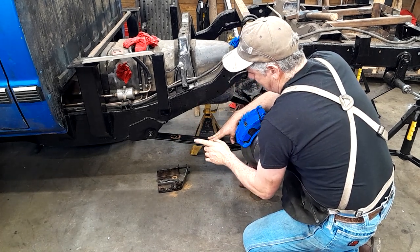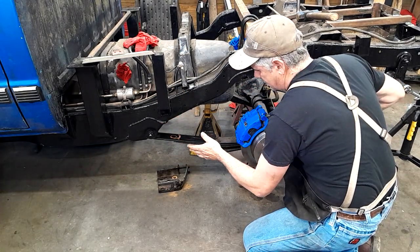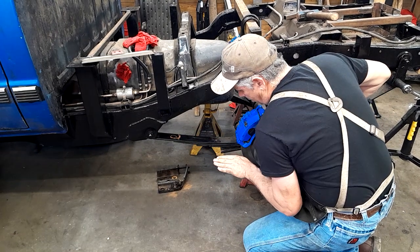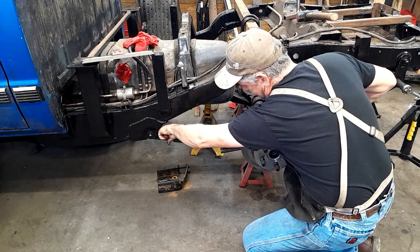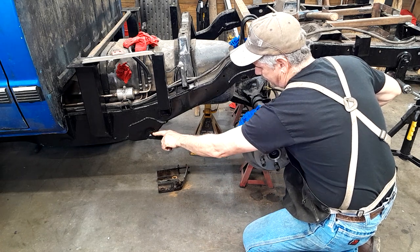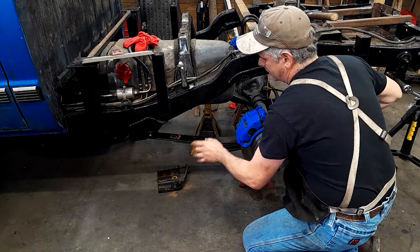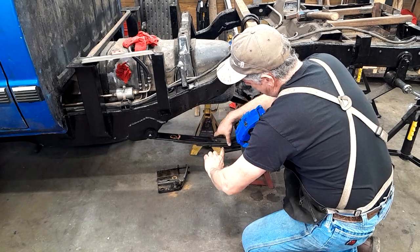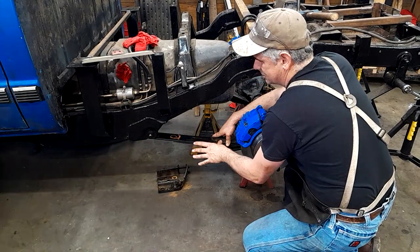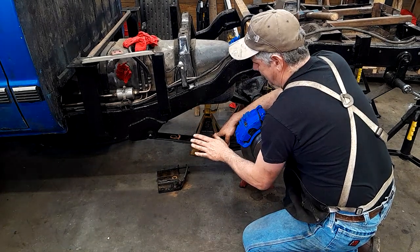But what a lot of people don't think about is all of your thrust. This rig's 180 horsepower, which ain't a whole lot. They are American horses, not Chinese horses. The important part is all of your forward thrust is pushing through this 2.5 inch wide piece of steel, through this one bolt on either side. That is transferring all of the thrust into the 3,000 pound truck. So this actually will have an S-bend in it on hard launches, which is probably not going to be relevant on this rig because we're not going to drag this. This is not a 600 horsepower drag car.